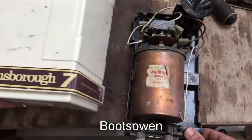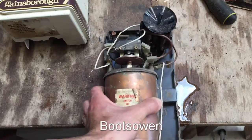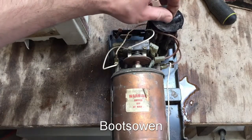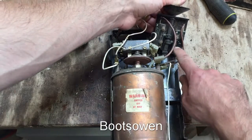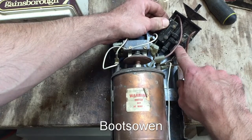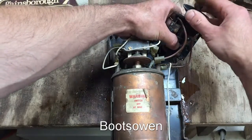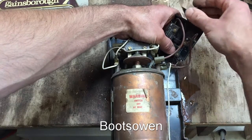Inside, if you were to imagine the cover on top, inside you've got this unit here. The knob is this thing and it's broken off, so if I just lift it over like that — it's got two micro switches, or actually they're not quite that small but they're probably still considered micro switches. As you rotate the knob it turns on one, the other, or both.